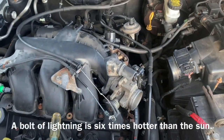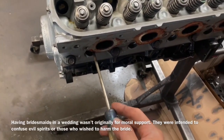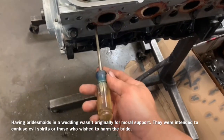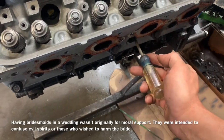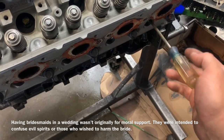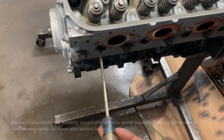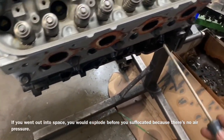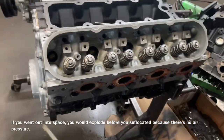When the piston is up, you can't insert the screwdriver very far — that's as far as it'll go. But when you go to a cylinder with the piston down, you can insert it quite a bit and it'll go really far inside there. You can clearly see the difference: piston up means almost no screwdriver fits in; piston down at the bottom means you can get almost the whole length of the screwdriver in there.